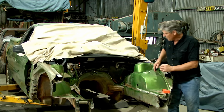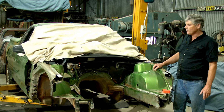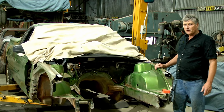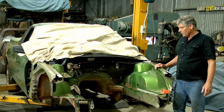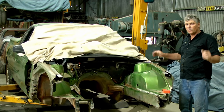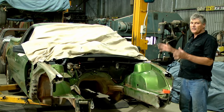First off, we need to look at the fact we've got this car on a hoist, and now that we've got a significant amount of the weight removed, it becomes a little bit unstable. For all my old mates in the trade, we're aware that you've got to load a two-post hoist so the car pretty much balances across the two poles, which is easy when you've got an intact car.